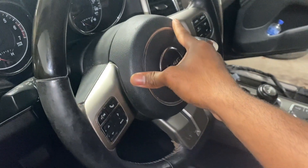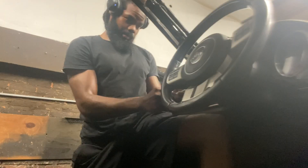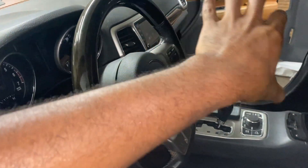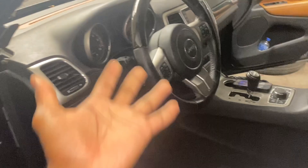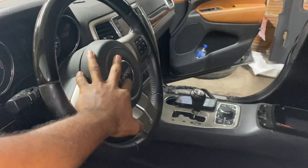Make sure you've got everything connected, then set the airbag back in place and put the bolts in. It was two 10-millimeter bolts — they go into the hole here, tighten down, and there's one on the opposite side as well. There we go — the brand new airbag is on. The interior is actually looking pretty much complete at this point. It's crazy how just a small piece can make the whole interior come together. Now we're about to move to the front end of the vehicle.